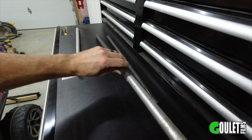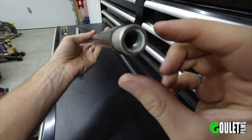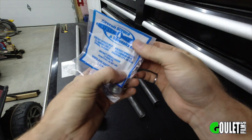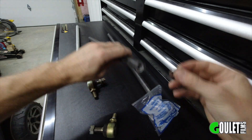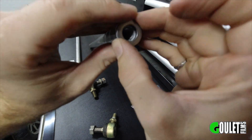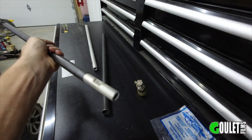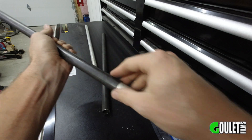Look how nice those fit — it's so perfect. What I'm going to do is put some glue in there so that they don't spin. My plan is to use these washers from that same aircraft store — I'll put a link in the description for the exact washers. That should retain the chromoly since it's the exact same diameter, and then this just gets threaded on and pinches it in there. Then I'll just splash some paint on them and bolt everything together, and we're done for the front tie rods. I'm going to clean these up first before I glue them, just to make sure we get good adhesion.